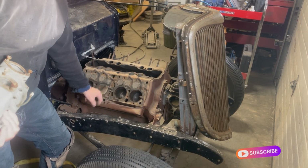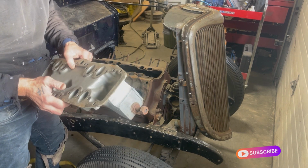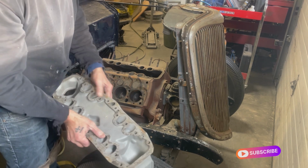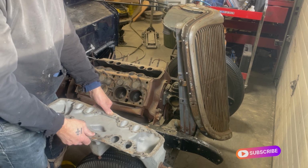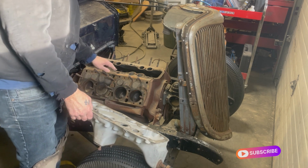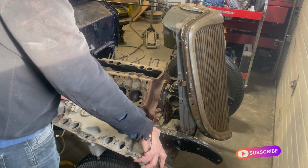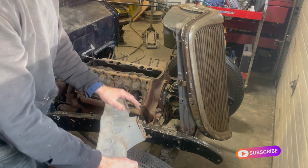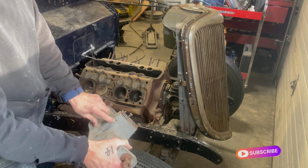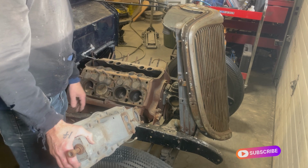It goes out through these two ports, but it also comes up into here, up this hole, and into the intake. Now I've heard of guys putting pennies in here and blocking this. Some say it changes the sound, some say they don't run good after, some say they run good after you warm them up. So you never know. I might be tempted to do that. I could fill that with JB Weld, because apparently they get quite thin. Obviously they must, thin enough to get a hole in them. And I could run it like that.